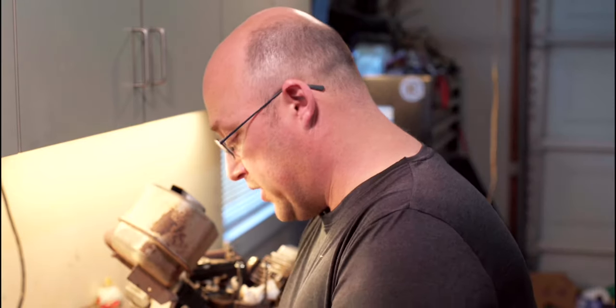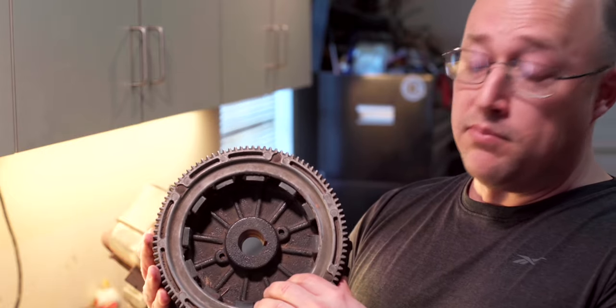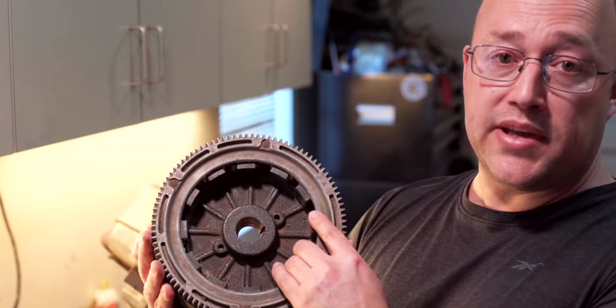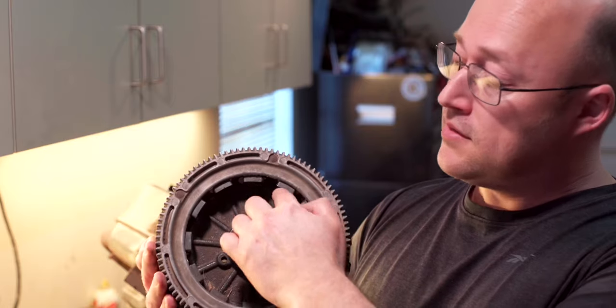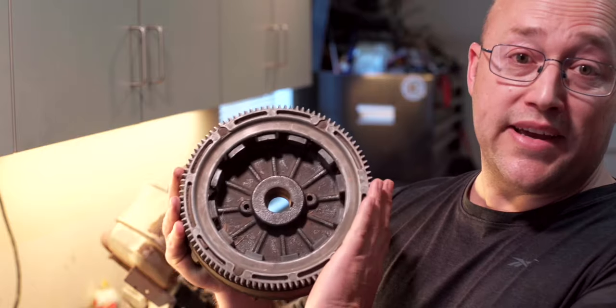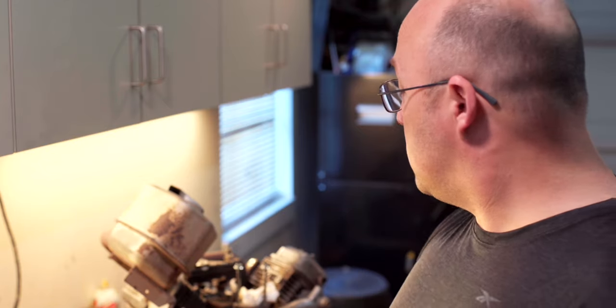As a side note, one other thing I noticed on this engine while breaking it down was all of the magnets were basically just held on by compacted dirt. I went ahead and took them off, cleaned the surface with a Dremel wire brush, and then each one of these has been re-epoxied on into the exact spot it was. So now, this should be good as new. This had to come off because the charging system is a single wire for the Great Dane, so I took it off the 18 horsepower and installed it on the 16.